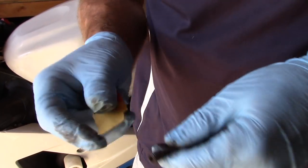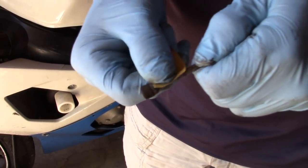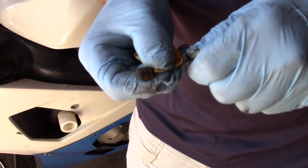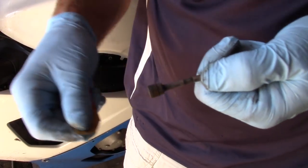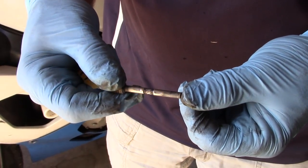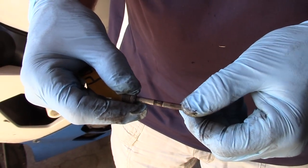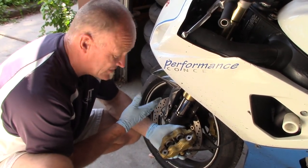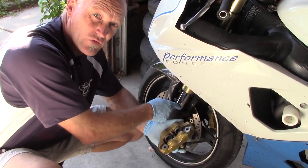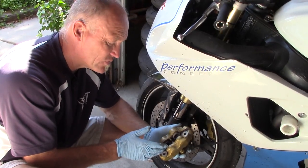Now that's done. The pin is much cleaner — a much more even surface with no crud built up that could hang the pads up. Our other caliper is still firmly attached in place, so when we move these pistons it's not going to move those pistons and then have them fall out — that's a very common mistake. Whenever you're working with brakes, only one caliper at a time.